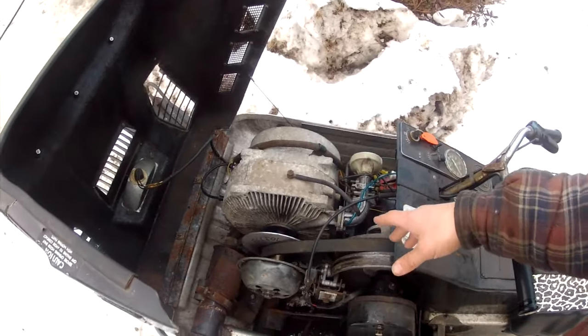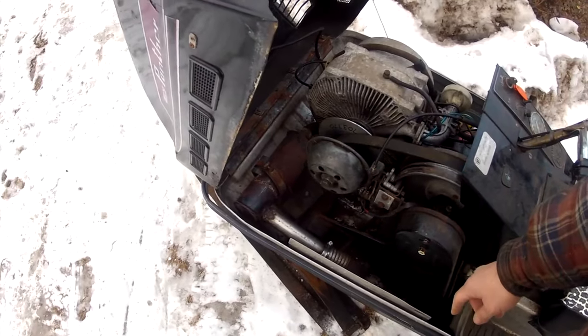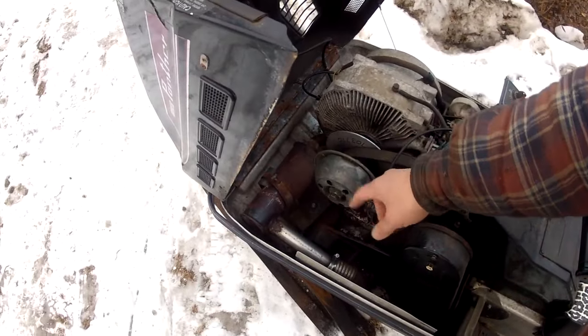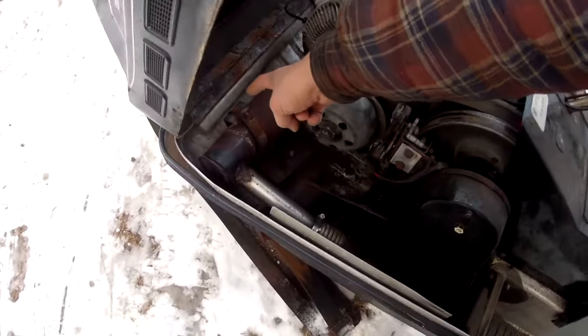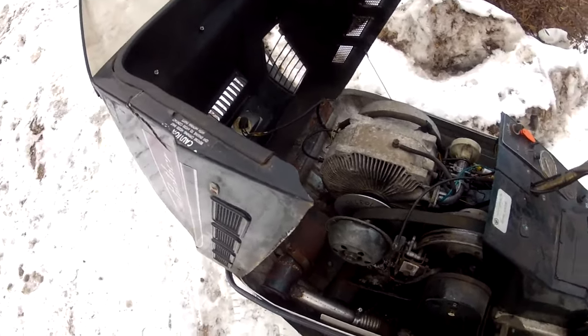This is a replacement clutch that somebody helped me get. It's got new crank seals. The exhaust on these rusts out — it sits in kind of a funny place at a funny angle. This is actually a Cub Cadet tractor exhaust, and it's been shortened along that cut line. Today I welded this in so that it'll actually stay in place; I had trouble with it getting loose.